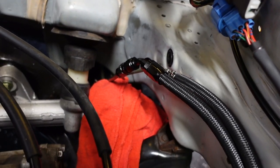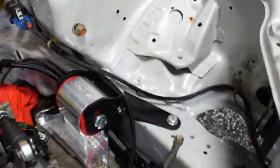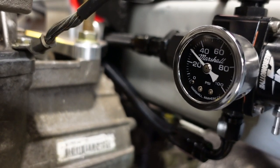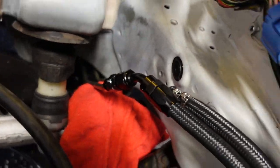Like a leak. I'm not gonna hold you. You're not leaking. Pause. Got fuel pressure? Holding 30? No, sir. You've got no fuel leak holding 30 pounds. You want to crank that up a little bit, see if it can hold like a standard 60? Bro, if it holds 30, it's gonna hold 60. That's on there. Not one leak, Trap.